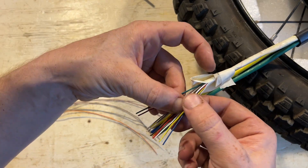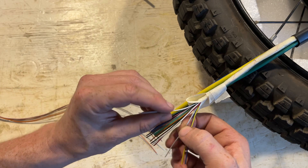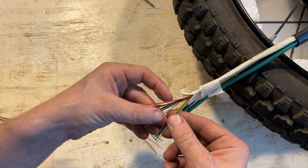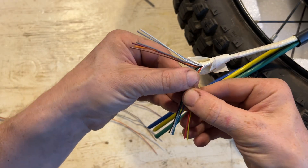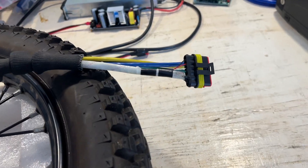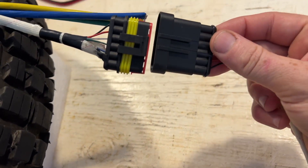I notice there are two silver lines — I don't know which is for which, but I can use either one. Both go to the same motor temperature sensor, or maybe to two different motor temperature sensors, but they'll be sensing the same temperature. The temperature sensor does not need a power source, so it really doesn't matter which one I use. My phone died, but I managed to crimp the terminals on each of the hall lines, and then that connects with the other side of this thing, just like that.